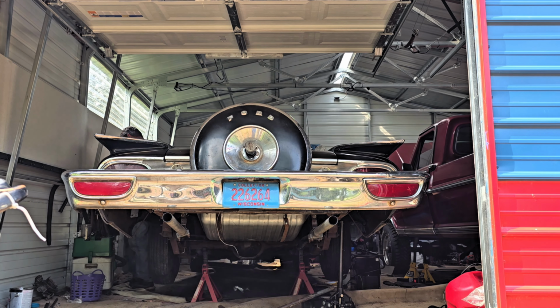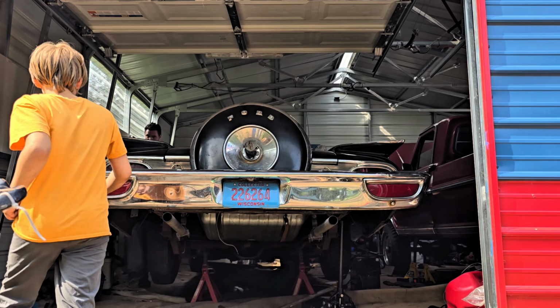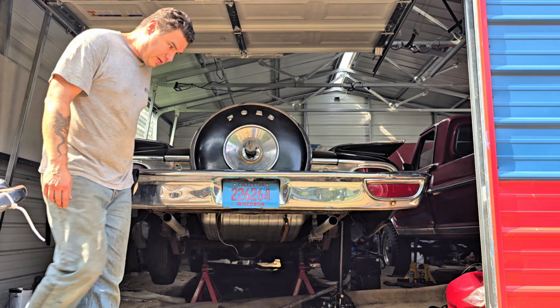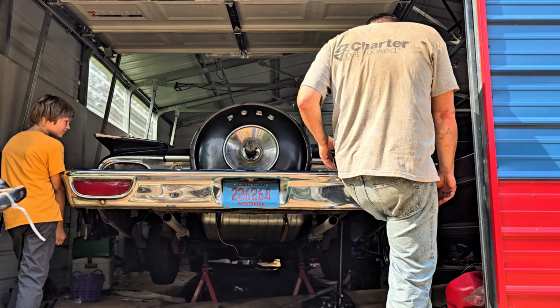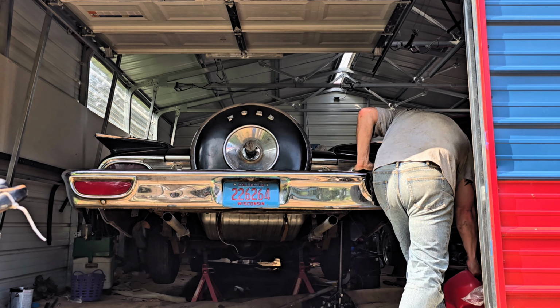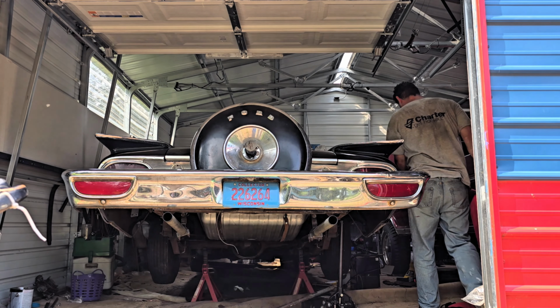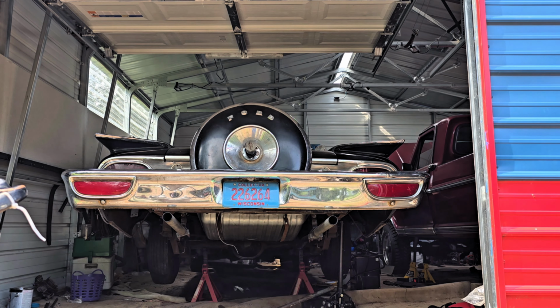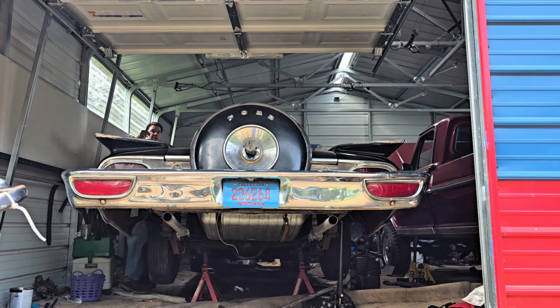Put some gas in the carburetor to prime it. And add some gas to the carburetor because it's got a long ways to suck the gas from the gas tank. Well, now we know it worked. Try again.